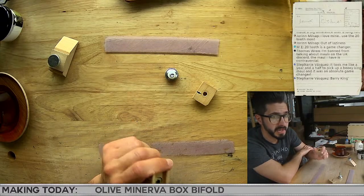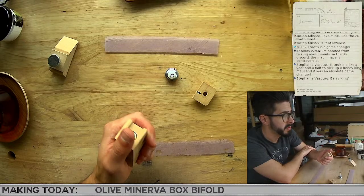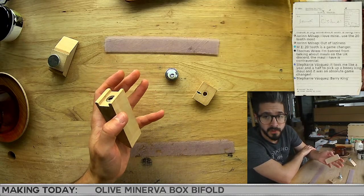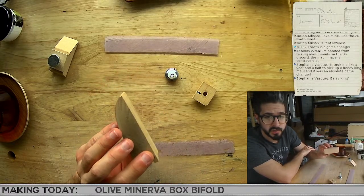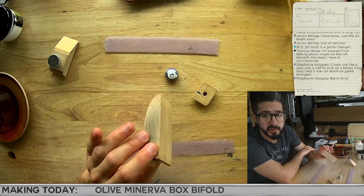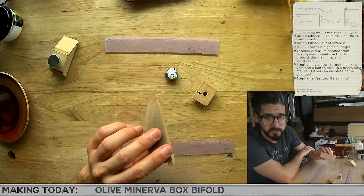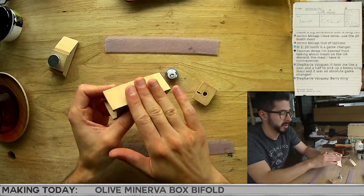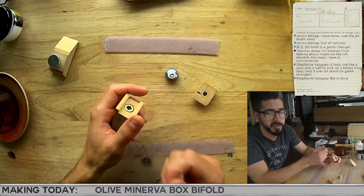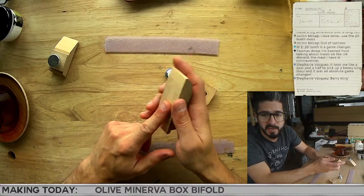When you're trying to get things out the door, when you have a time frame to meet, which anybody doing this on a production basis does, you want to do it efficiently. So for how much this tool costs, like I said, $8, there is no reason not to be using one. I mean, you can get one for free. Anything that is long and hard like this can be a sanding block. Rulers work great for this. I've seen countless body techs using Bondo spreaders with sandpaper on them, or the classic paint mixing sticks.